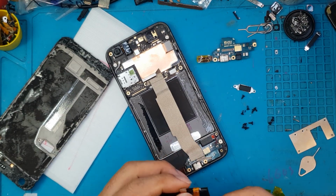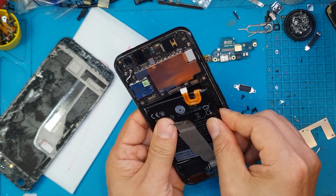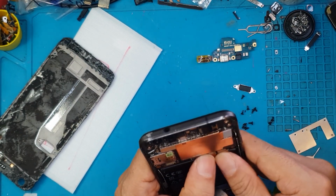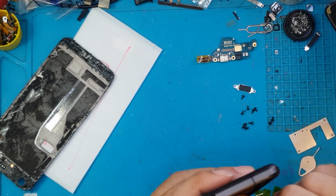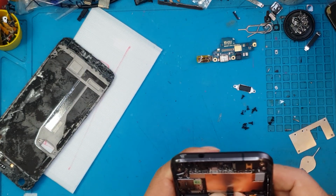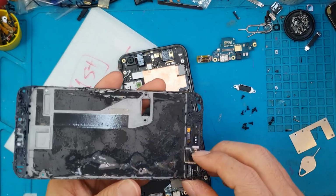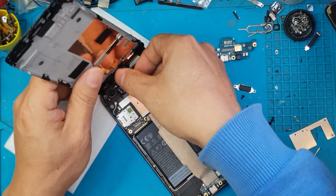And now we have our second brand new part. This is the new battery. This is gonna be slotted in. There's adhesive underneath the battery. We are gonna reconnect it, and then the flex cable from the charging port will have to be reattached as well. That's it. I think we have to cover this up now. We have the connector, one final connector right there.